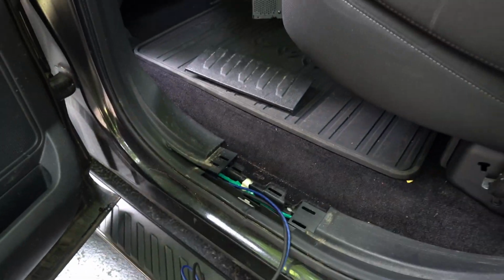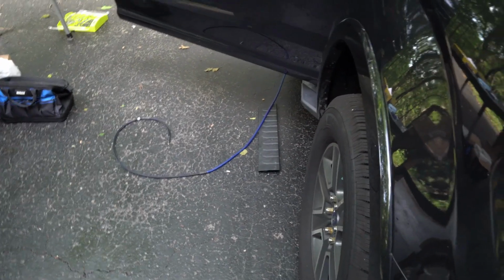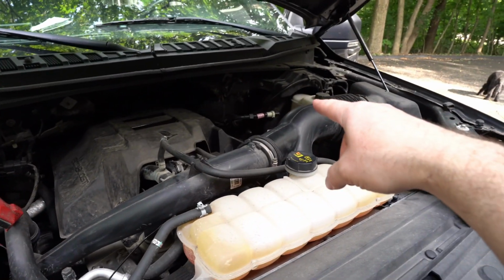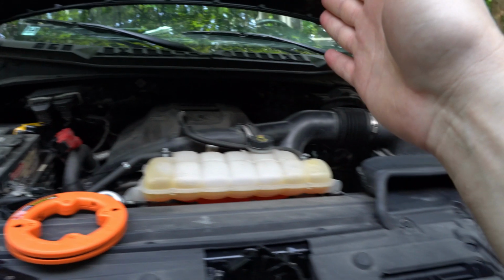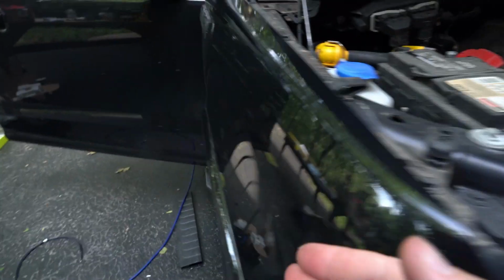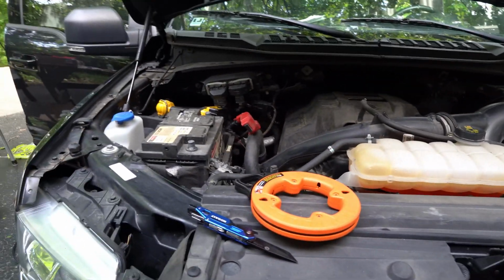Perfect. So now they are through the doors. I will need to run the power cable, which I've got laying on the ground there, through either this side or that side. And unfortunately, because I want to run power on one side and RCA cables on the other, that way the power doesn't cause interference electronically with the RCA cable. So one on one side, one on the other.